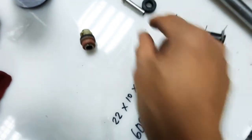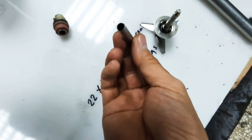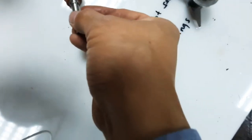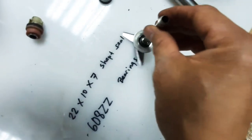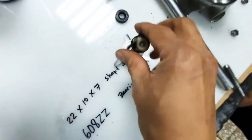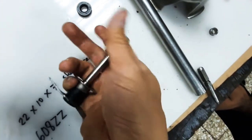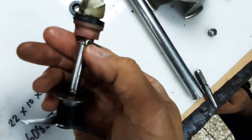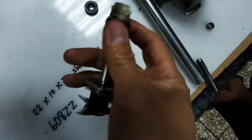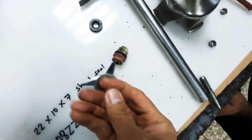Let me show you how this thing is assembled. You have the blade shafting, then the bush or sleeve — make sure this sleeve inserts here. Then you put the attachment like this. These are all inserted inside the main connecting hub. Now we will assemble it in the main impeller housing.